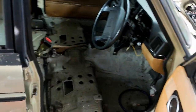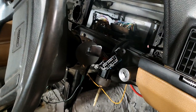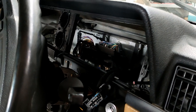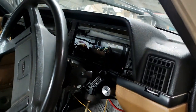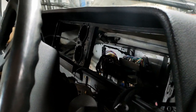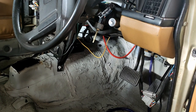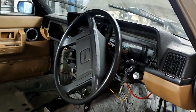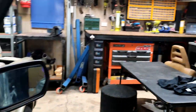I've pushed the car down off the hoist and moved it forward to work on the wiring. There are a few things to do: I needed to put a relay on the brake switch so that when my foot's off the brake it powers the PCM for the lock-up converter. A 5-pin relay was needed for that and that's in now. I also need to put some more wiring in, get a constant power to the dash and to the gauge pods that will go across there, and wire in power for the wideband — it only needs 3 amps so it shouldn't be a big deal.